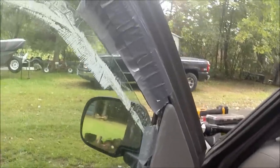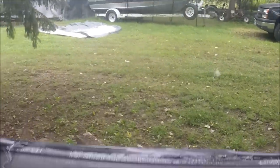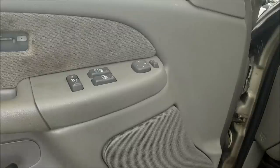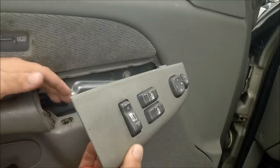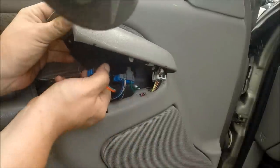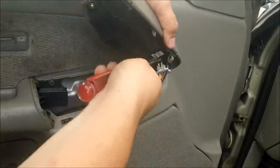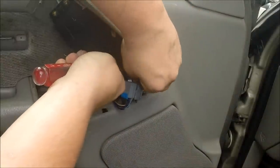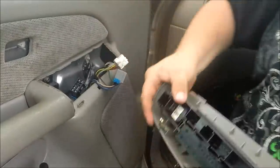So we've got to remove the door panel and remove any duct tape holding this thing up — which is going to be great to clean, but we've got to remove it. Remove the window switch assembly. Pull this over; it's quite easy to just unplug these. Wiggle it and you'll get it. Undo this screw right here.